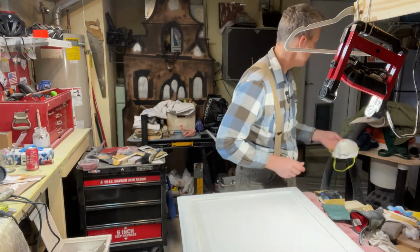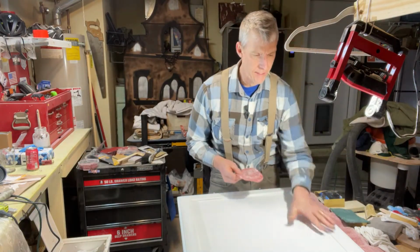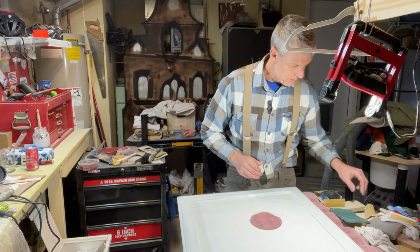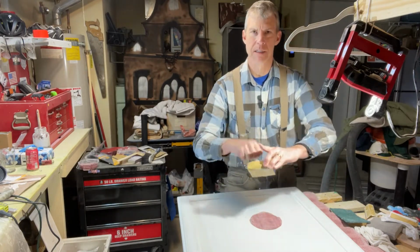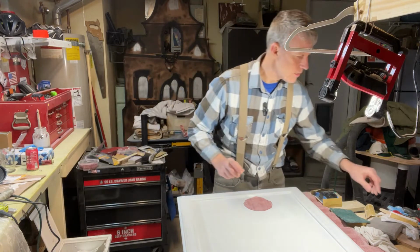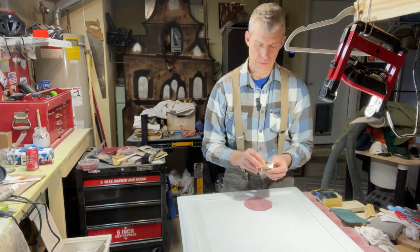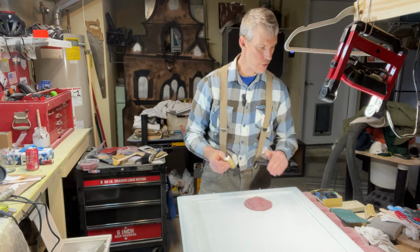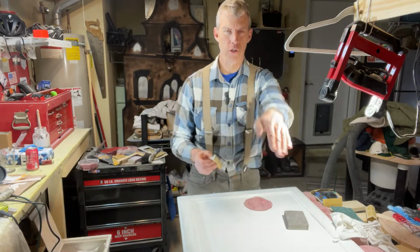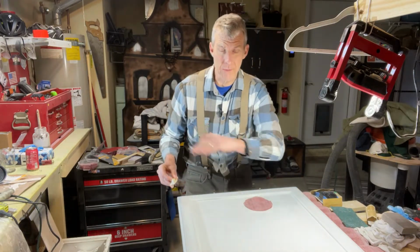So I have a variety of tools that I'm using for this. So for one, after the Scotch-Brite, then I'll inspect and I'll see what's needed. So if it's a rounded, a soft area, I'll use the soft sanding. If it's a big area like this, I will use my sanding block so I can get a nice smooth finish. If it's along this edge here, so this is a little bit of molding that I had, and I just wrap some sandpaper on it, and what that does is it's a straight flat finish, but it doesn't curve at all. For example, the sponge is a flat finish, but it will curve and contour, and I don't really want the contours at this point if I can help it. I want everything to be smooth and flat as I can.